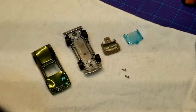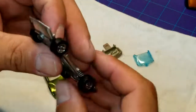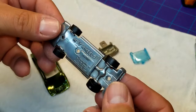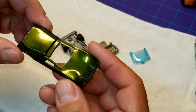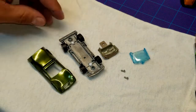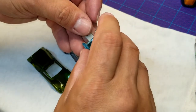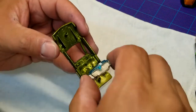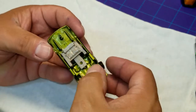Not quite sure what to expect as the color gets built on there. It's looking a little gold in the video but it actually looks a lot more limey than gold. Coat two went on pretty good. Coat three — we ought to be able to get a nice saturation coat and bring out that lime apple color a little bit more. Looking pretty good, everything's going on nice. This coat's going on a little heavier than usual, but in the light you can kind of see that apple color. Looks pretty good. We hit that with a little 2K clear.